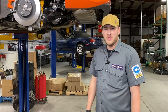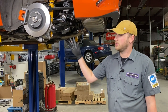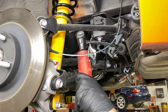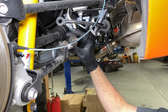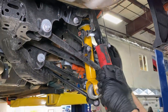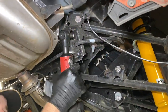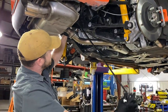Now let's go ahead and move on to the back. Here we are at the back of the car, ready to do the rear sway bar. I do have the back wheel and tire off — not necessary for the installation or removal, but we just did it so you can see better. We're going to begin by removing the end links on each side. Similar to the front, the ball sometimes spins and the nut won't come off — if that's the case, use a 5mm hex key to hold the stud stationary while you use a wrench to remove the nut. Repeat for the passenger side. The nuts that hold the bracket onto the rear require a 12mm socket, so we'll remove the two nuts on each side. To remove the bar, simply slide it off the studs and work it over the exhaust pipe — just like that.